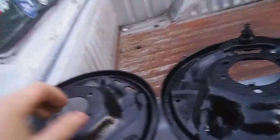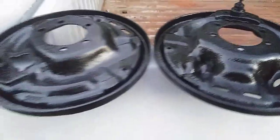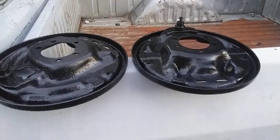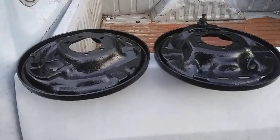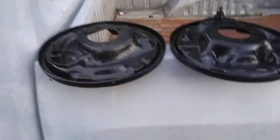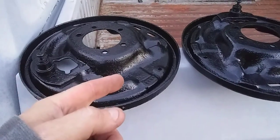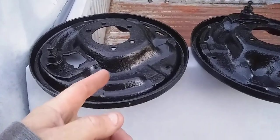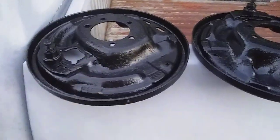Got these all done — three or four coats on each side of the VHT brand gloss black suspension epoxy paint. These are 11-inch drums. I wasn't going to fiddle around trying to locate a pair of 9-inch or 10-inch drums for the Dart, so 11s are plentiful, especially on pickups. I found these, and I got an extra one — if somebody's interested I can sandblast and paint it for them, or sell it as a bare rusty metal backing plate.